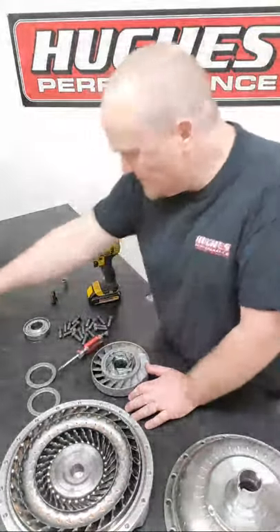With our stator, because it only has one stator cap, you can use the transmission side of the converter facing up to be sure you have it in the right way every time. The side of the stator with the removable stator cap should always face up towards the impeller - the transmission side of the converter. Clockwise rotation toward the transmission side, removable stator cap facing up - do that and you'll always have these parts oriented correctly. And if you were savvy and paying attention, you'll notice I put the diode in backwards the first time - see if any of you caught that.